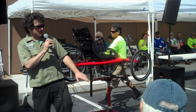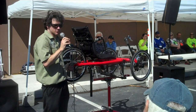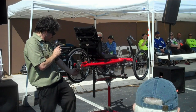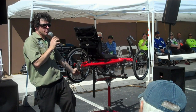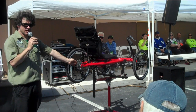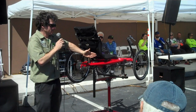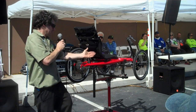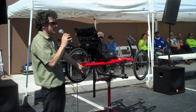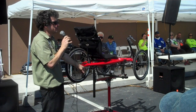And then the last thing with rear derailleurs is the alignment. This is actually a physical structural damage thing. The chain is running through those rollers, they're in a plane, and they should be in a plane with the cog that it's on. But what can happen is the derailleur can get twisted. It can get bent over. And it's this part of the frame here, which hangs down, that the derailleur attaches to. They specifically designed that so that it would bend.